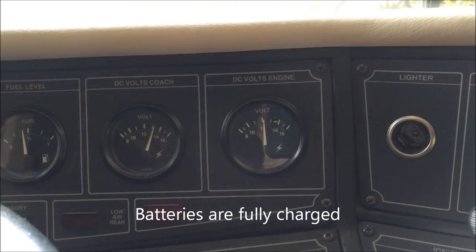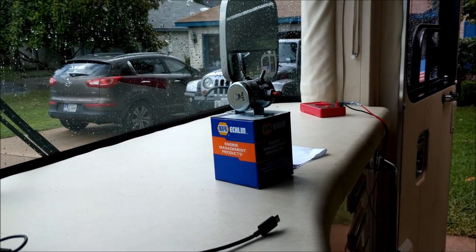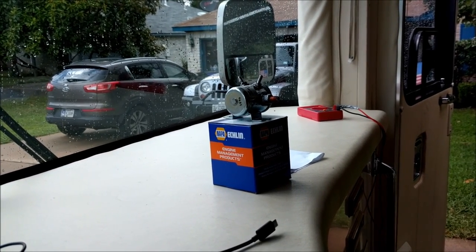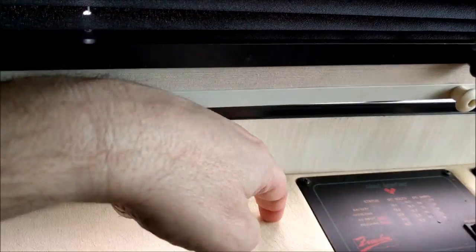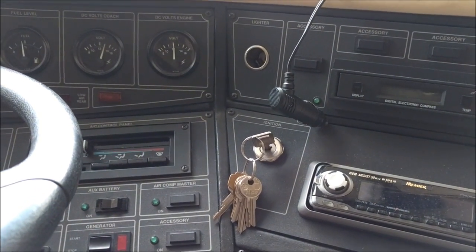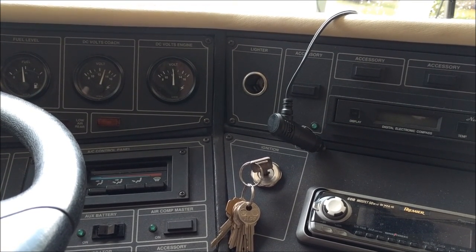I'm pretty sure it's that thing right there. Now that one on top is a spare I had in the spare parts — it's been used, but I believe it's a good used one. Was chasing a problem, replaced it, that wasn't it, threw it in the spare parts. So I just went to Napa and got another one. This is the constant-duty solenoid. It's right down here on the outside — there's a big panel that opens up. That's the 12-volt constant-duty solenoid for the engine circuit, the one that feeds power all the way back to the solenoid in the engine bay for the 12-volt stuff.